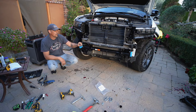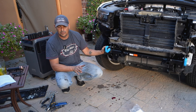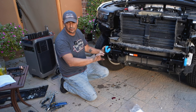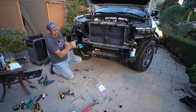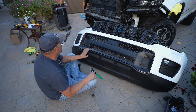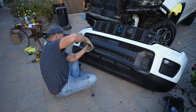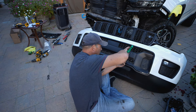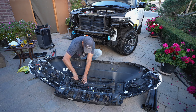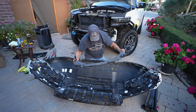So we're pretty close to reattaching the front fascia. We got the tow hooks installed, the base plate installed, and all the accessories reinstalled. Now what we're going to do is match up the fascia to this base plate so we can cut some holes in the fascia where our attachment hooks will pop through the front grill. We want to make those cuts as small as possible — so we're going to hold it up, mark it with some paint, then get some snips and cut the front fascia circles out. We put the fascia up against the Jeep and try to mark where those pegs and tow hooks are going to come through on each side. We also have to remove this foam piece from the inside of the fascia — it used to fit with the original bumper but it won't fit with the tow bar, so just take these clips off and pull it off.